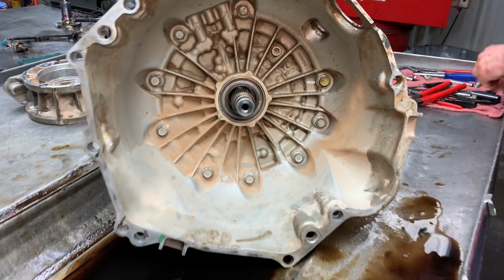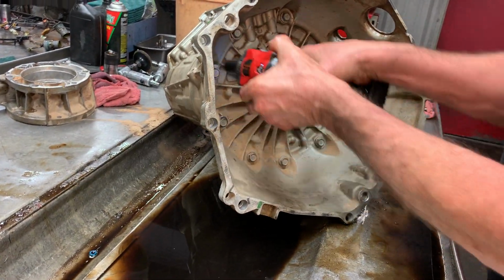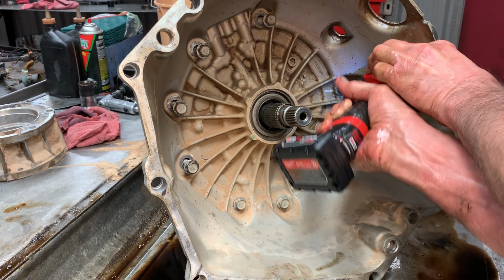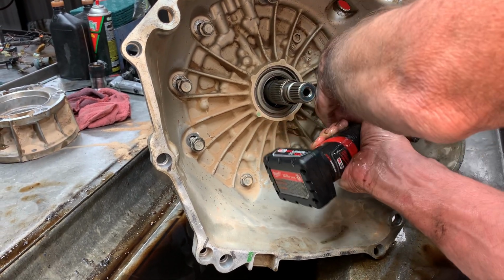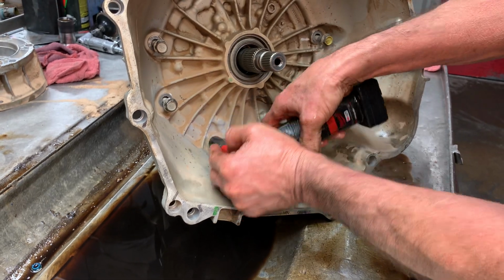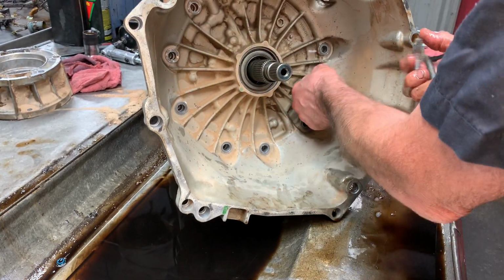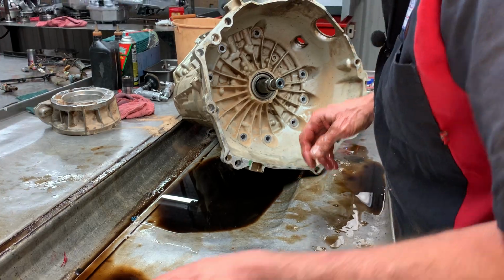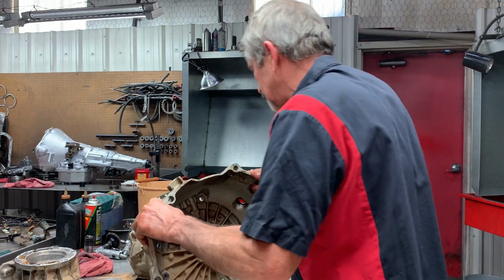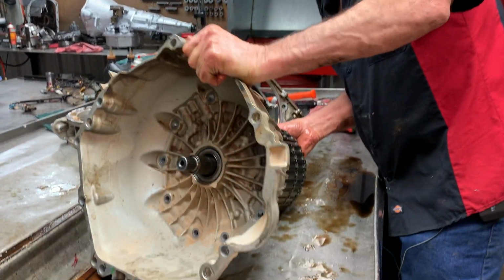If I can get in here on this thing. That's a bad boy. Yeah, it works. Works pretty good. You hear how hard that thing hits? I'm telling you. You can hear it. Works really good. Now this pump reminds me of the 4L60E pumps. They got a boost valve, pressure regulator valve, lockup valve, converter fill valve, all that type of stuff inside. So I'm going to pull this out real quick, real gentle, so you guys can get a general idea what this thing looks like.